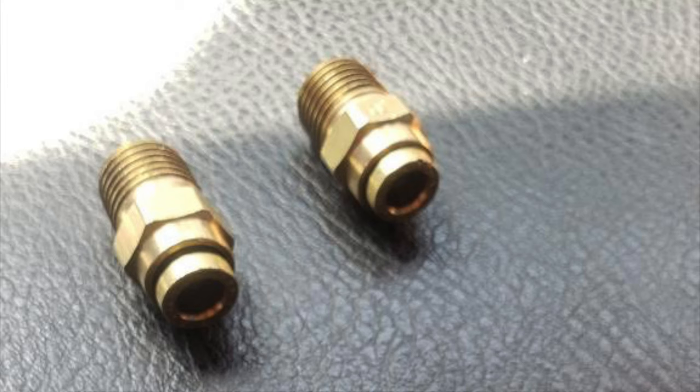What you should do is go to truck stops that sell fittings and buy steel or aluminum straight-style fittings. They're expensive — around $15 to $30 a fitting — but they're way stronger and more durable. We were able to flip it, drill a straight hole, and run the line properly. I haven't had any air leaks or issues since we changed out the fittings. Fittings are a big deal — go get some better ones.